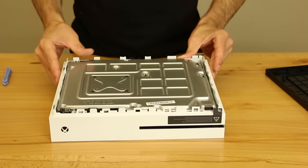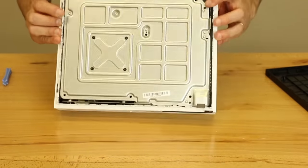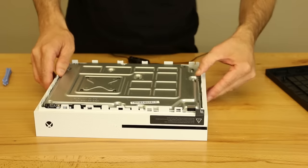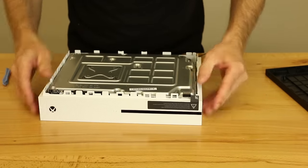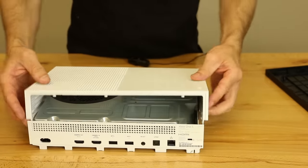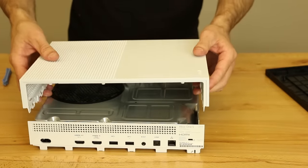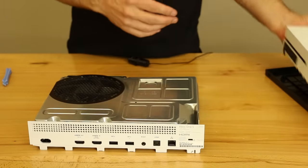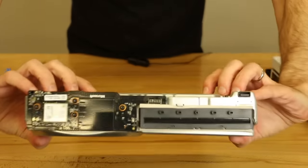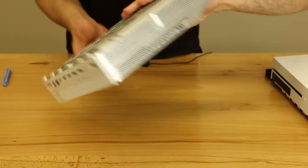Looks like we got all the green screws. I'm going to flip it over and see if this top case pops off — it must be held in by some clips. It looks like we've got some clips on the sides and maybe on the back here. This will slide up and then just pull out. You don't have any ribbon cables or anything like that to worry about like in the Xbox One — it just comes all free. So that's a nice thing about this. We've got the Wi-Fi module right here.